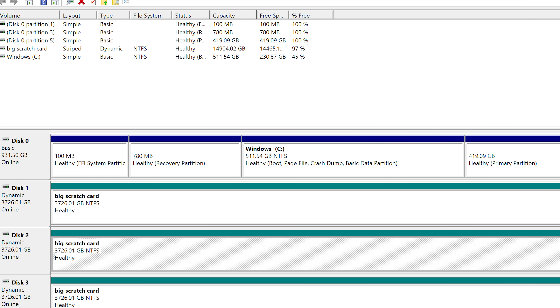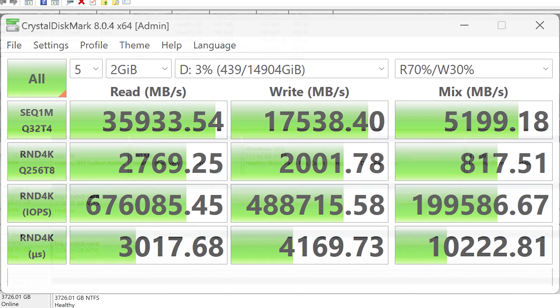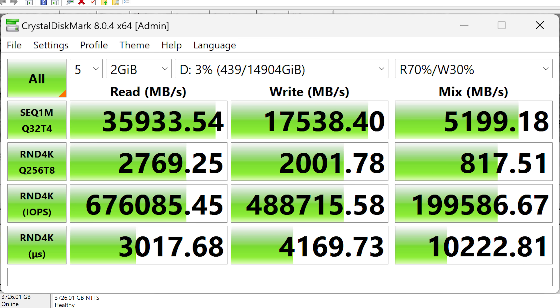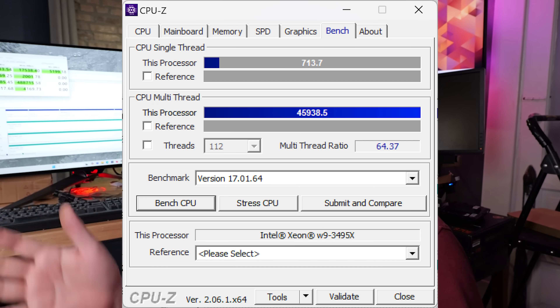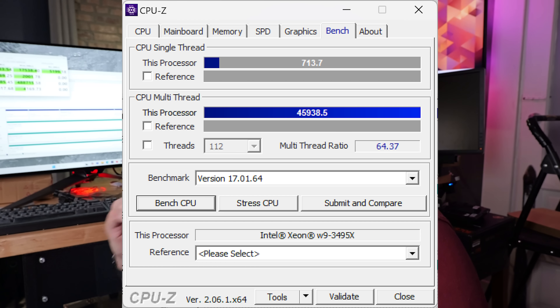It's a delightful hardware experience now that I've got an Icy Dock module to mix and match my M.2s. Each one is four terabytes and can do 16 gigabytes per second. Even so, CrystalDiskMark tops out at about 35.9 gigabytes per second — worst case scenario numbers in terms of performance. Keep in mind with a RAID volume, Q-depth one operations where you can't have many threads make it hard for one thread to keep devices this fast engaged across the whole platform. That's part of why I went with the Xeon X — I could overclock it heavily.